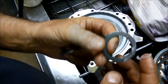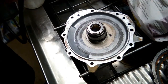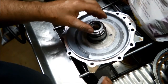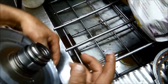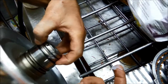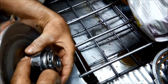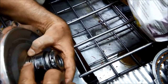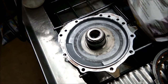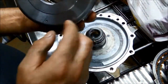The skid plate — you'll find it's worn on one side where the Torrington bearing was running, so I like to just flip it over. I'll put a little bit of Vaseline on there and do the same on the Torrington bearing. I might actually just stick those rings a little bit — I wouldn't want to cut them while I'm putting the drum back on. That'll just help hold them in a little bit better. Now I can put the drum back on.